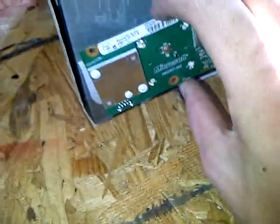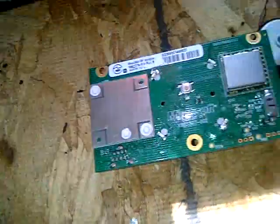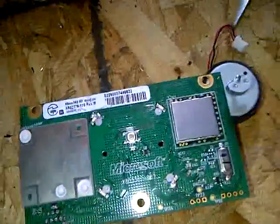And you need to remove that. Then you're going to pull this — it has a little thing like that. You're going to pull it from the console. It's going to be sitting like this. You're just going to pull it straight out and set it down. I found out that the rumble packs have a spare one laying around — it's perfect to make it flat. Take your soldering iron; mine is butane. Solder right there.